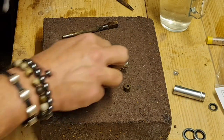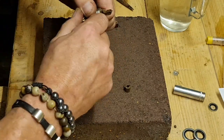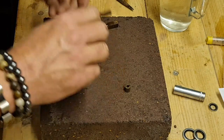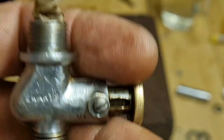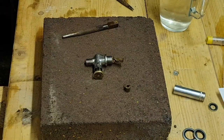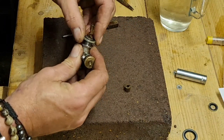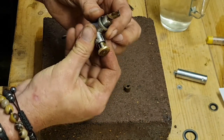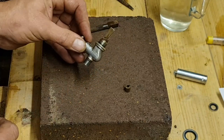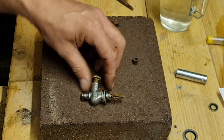So here is our tap with its new cork. Oh yeah - absolutely perfect. If you wonder what that tap is, it's an Ewarts tap. And we have replaced a cork successfully. Which one of these washers fits over there? There's the little washer we're going to need for our petrol tank - look at that, that's ready to screw back in the BSA tank. The filter strainer is all clear - I've cleaned all that out already - so there we go, we are sorted. There is our tap done with our little washer on there.